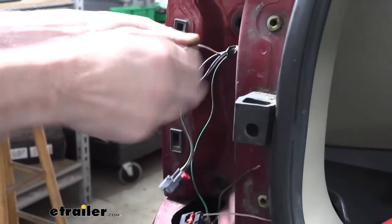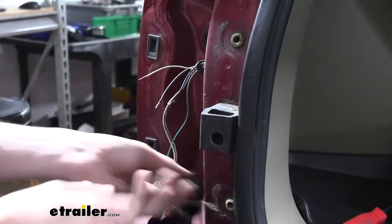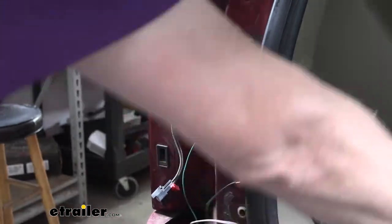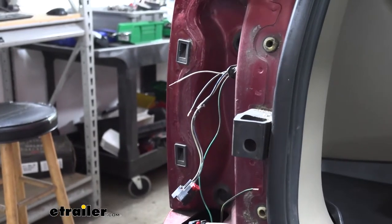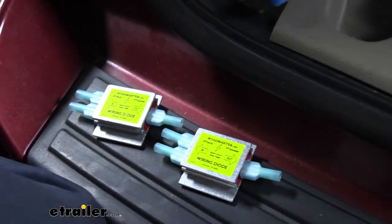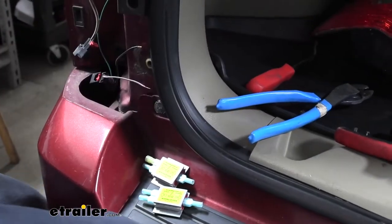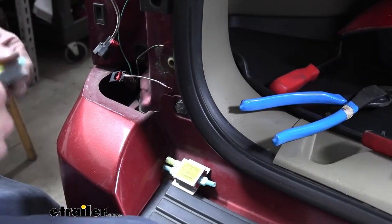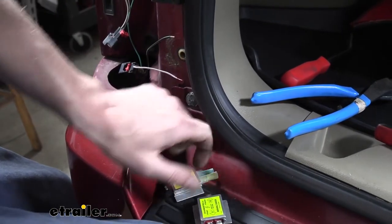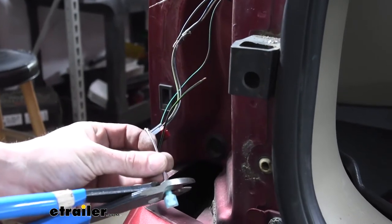Once we get each one stripped back, in your kit you're going to get a bunch of diodes. We're going to be wiring diodes in-line between these circuits. Our diodes aren't going to be a hardwired connection — it's just going to be spade terminals that plug over the ends. So we're going to twist the ends here just to make the wires slide into the spade connectors easier. We're going to open up our diodes — there you can see the diode. We're going to have two of these on each side. One of them, which we need here on the driver's side, has a yellow one — go ahead and save that for this side. The ones that are all blue we'll use over on the other side. Go ahead and peel off four of the blue spade terminals — we're going to be using four of those for now. Each one of the wires that we had just stripped back, we're going to place one of these blue spade terminals on. Just slide it in the back of your spade terminal and crimp it down.